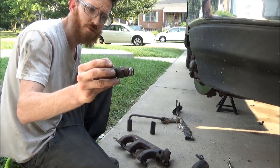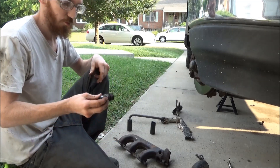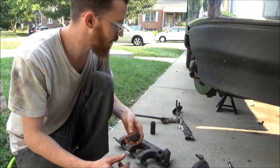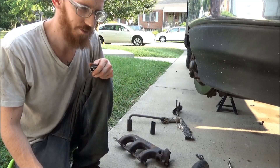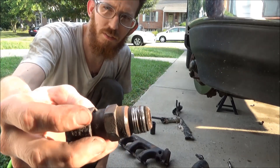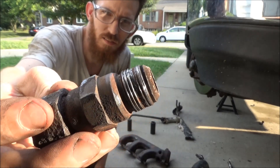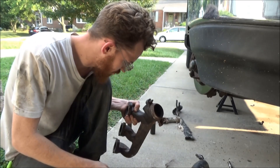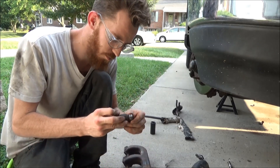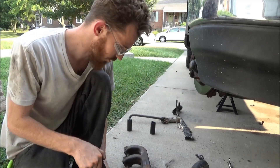I just wanted to actually pull the fitting out. The line was not coming out and it didn't. I had this in glowing red hot and it would not come off. You can only put so much torque on a wrench whenever it's in the truck, and you don't want to go too crazy because then you smash your hand on the side of the block. You can tell these threads are pretty galled up. I'll probably try tapping this one out too. This one has a couple of good threads and I might slit it and run it through, but I'll put high temp anti-seize on this stuff whenever I put it back together.